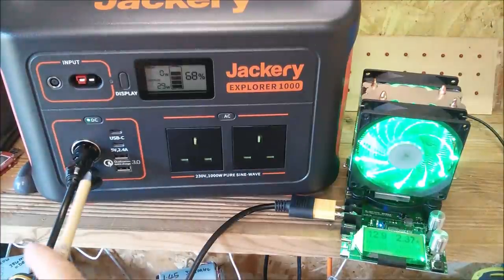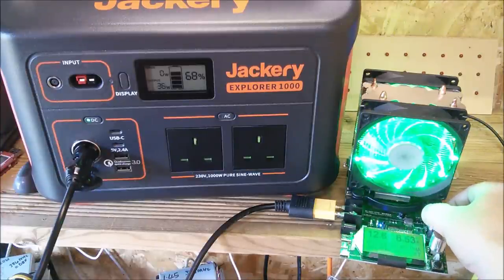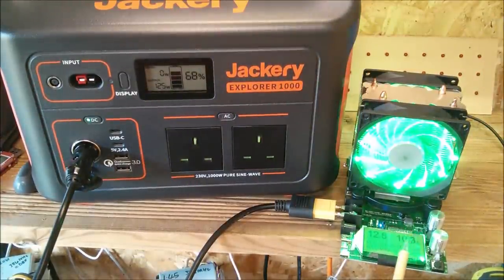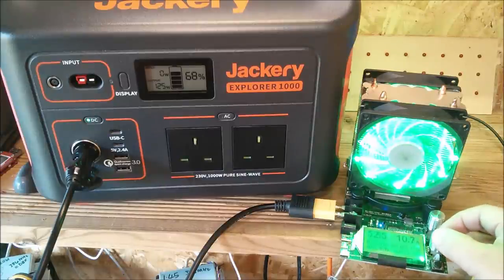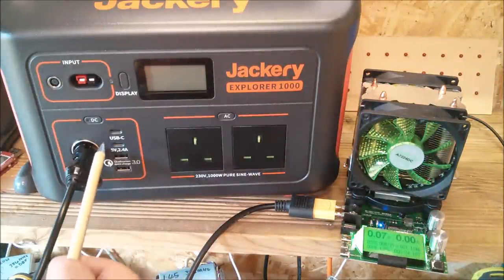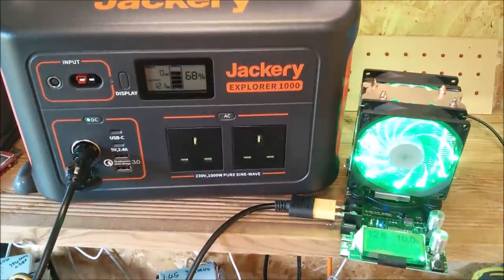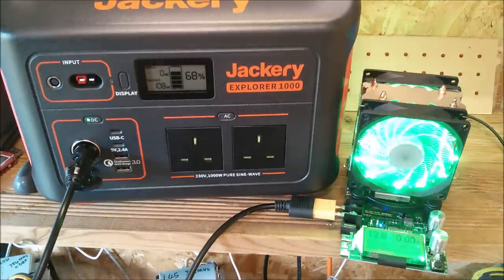Let's do a DC power test from the 12 volt cigarette lighter accessory socket. At 2.3 amps, raising up to 6.5 amps, then 10.7 amps and that's cut out. So it's somewhere around 10 amps — repeating that, it's producing 10.3 amps, 125 watts on the display. Raising that up to 10.6, 10.7, 10.9 and the output drops away. So this has a limit at around 10.5 amps — it is a protected output. The voltage at 10 amps is 12.5 volts, and at no load it's 12.9 volts.